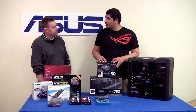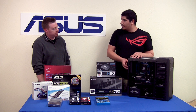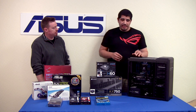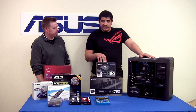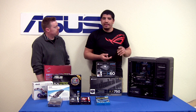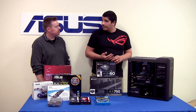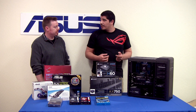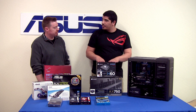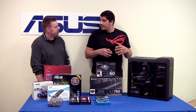This cooler comes included with a 4-pin fan, so we didn't need to get a separate controllable 4-pin fan for the H60. One thing to keep in mind is that the H60's cooling performance is going to really shine at normal everyday usage - web browsing, Blu-ray playback, gaming. But when you talk about content creation with a lot of rendering and filters, that can use a lot more processing power than even the latest game engines, and you could start pushing some of the thermal limits of this cooler at high voltages and frequencies.